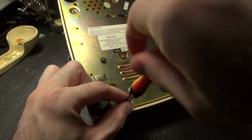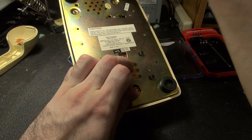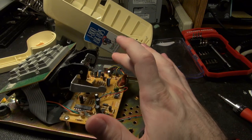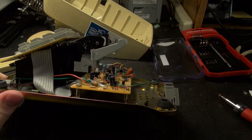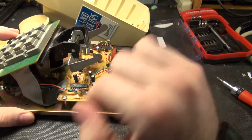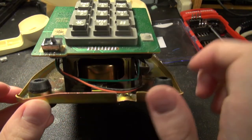Disconnect it from the wall before servicing — who would have thought? That doesn't sound intelligent or anything. I'd rather just play with actual landline power. This can pick up the handset receiver — it's actually a really cool way they did it. So when the handset's put down, it actually pushes one of these switches. That's kind of a cheating way to figure it out. Here's our actual landline connector — nothing exciting, two wires. Here's our little ringer we'll play with in a second.